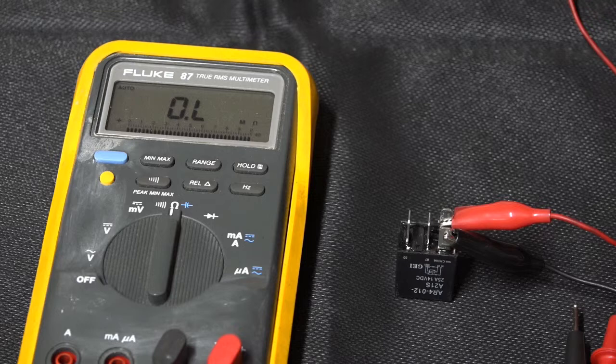All right, now, we've got another issue that we need to deal with: how to determine whether that diode is okay or not. Now, you can't check the diode in this circuit with a diode checker on a meter. If you attempted to check it in the diode check, it's going to show you it's a shorted diode. You're going to have very little voltage in either direction. So one way of checking, and I don't 100% like this, is using a test light.